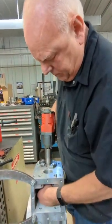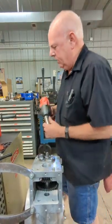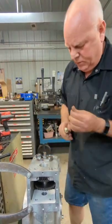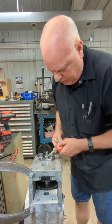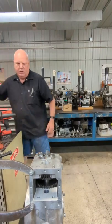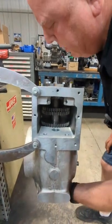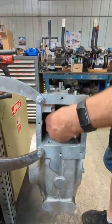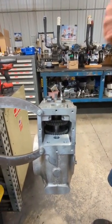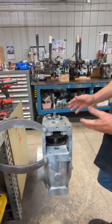What I usually do — I just run this thing down here. I use a Milwaukee half-inch impact; don't run it down too tight. Then I'll take and put some 290 wicking grade Loctite, put that right on those threads and it'll wick down there and seal those threads up and keep that nut from backing off. Now when that's tight, that should pull that pinion up. Now it spins nice and easy. That is it — that's all you've got to do and it will never break, because that bearing's got a couple of cone bearings and it can take a lot more thrust load than a ball bearing can.